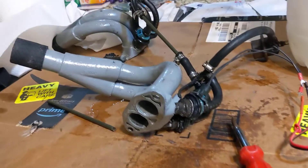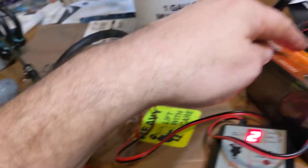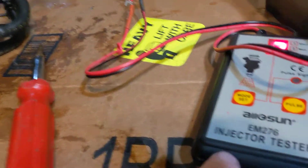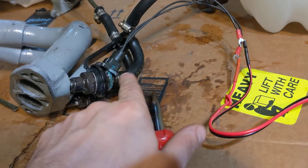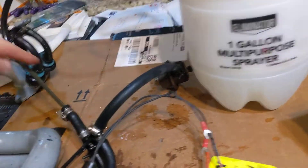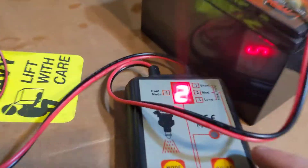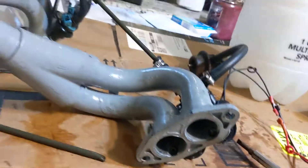I'm working on testing the other fuel rail for the 1978 Super Beetle fuel injected. I got the battery hooked up to this pulser off eBay to the pigtail EV1 Bosch into the thing, and I got my little spray gallon with water and soap hooked up in a tube and a pressure regulator. I set that for two pulses and you'll see water shoot right out of that little injector.